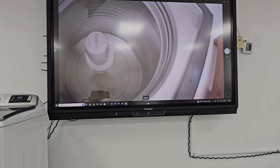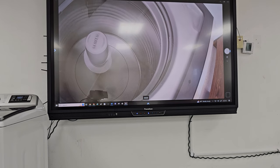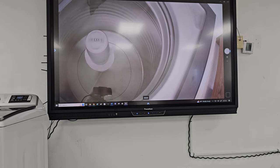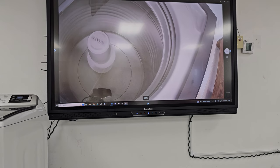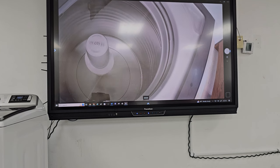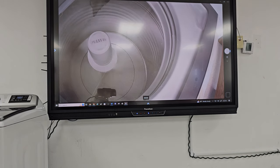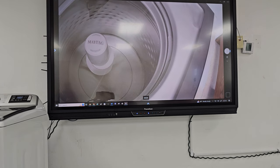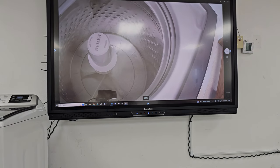Why does it take time for the washing machine to ramp up to speed? Why doesn't it just go right into spin? Dispersing the clothes as well? Well, in calibration, you wouldn't have clothes in it, but yes, most of these machines, when they go in a spin cycle, they don't go from 0 to 100 right away. They slowly raise the speed of the machine, because if the machine's off balance and it went to maximum speed right away, the machine would tear itself apart.